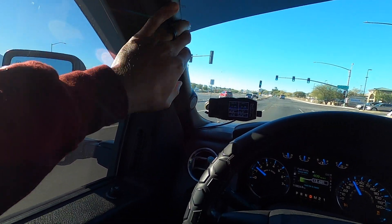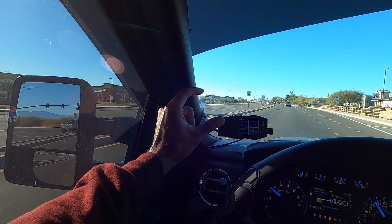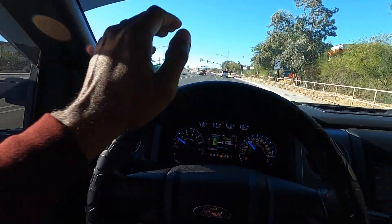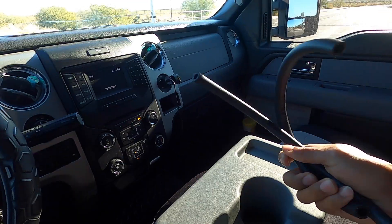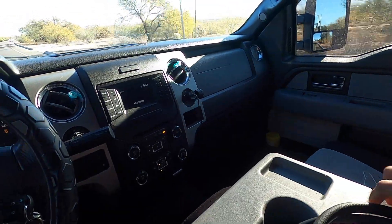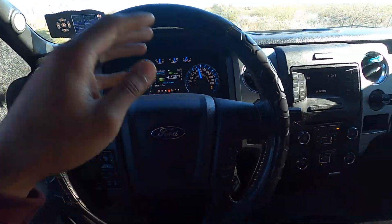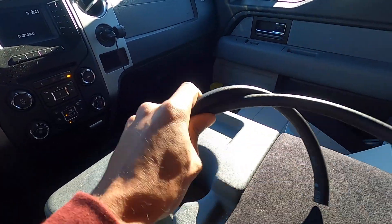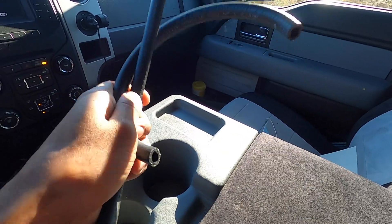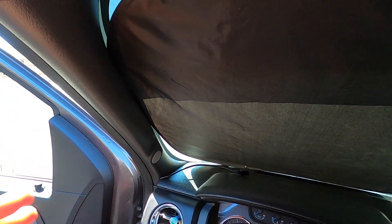The sensor is gonna go right here with a whole new gauge pod that retains the factory speaker mount, with the gauge part up here just a little bit closer. It's been a while since I've done a modification on this truck, so it's about time. I picked up two different diameters of fuel hoses — one's a 5/16 and one's a 3/8 — for the ethanol content sensor. We have to tap into the fuel line, and I didn't want to make any cuts into the existing fuel system, so I'm actually gonna create a little adapter to connect the content sensor to these hoses and mate up to the OEM fuel lines.